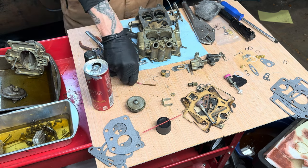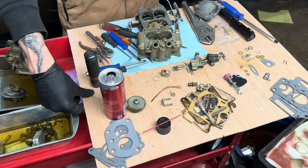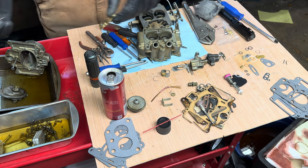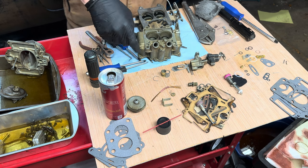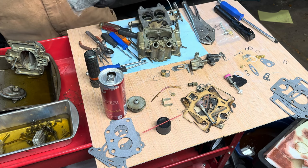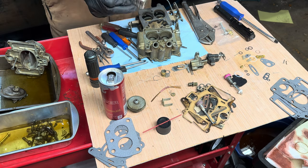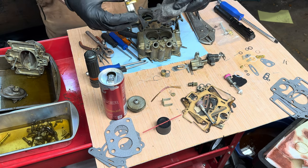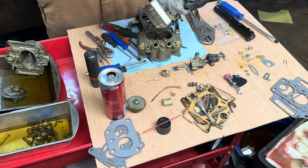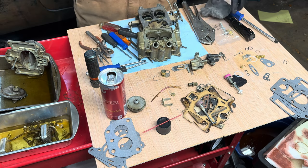And then you take some wire and you rip one of them out of there and you got to go through and poke out every one of these little holes. And then let's see what else. Some steel wool to clean everything up, like any of the dust and debris that you see. Try not to bend these guys either. The angle of this determines when the fuel cuts on and off, so don't mess with that.